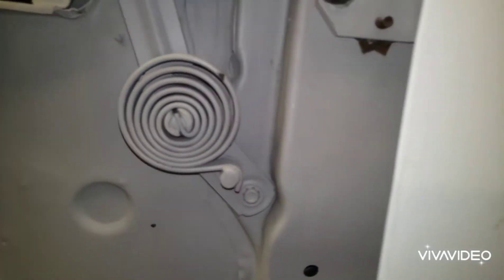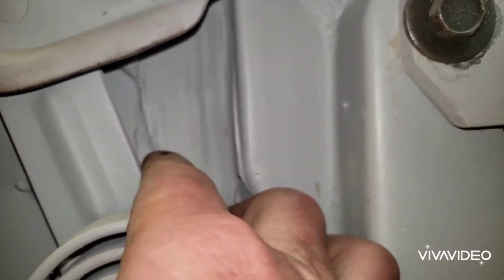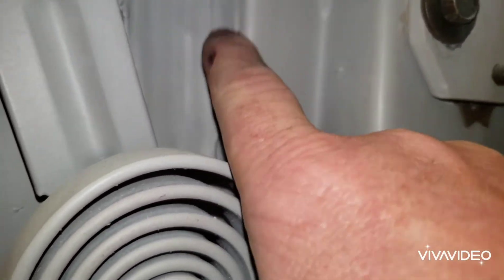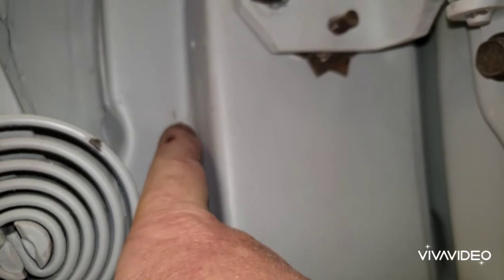It keeps flash rusting — I've got metal shavings down there that stuck in the wet primer and it keeps rusting on top of it, not under the metal, it's on top of it. I'll get a little nylon brush and something to clean it out. I'm not bothering to take the hood ends off. From the looks of it, it's still got some seam sealer from the factory up in there. Up in there is one area I'm talking about, and here's another. There's also a spot where I welded on the inside and it burnt some of the paint off — got to fix that.